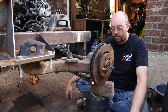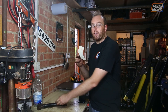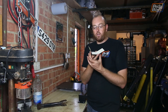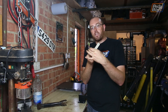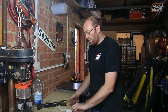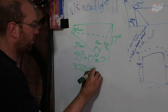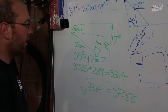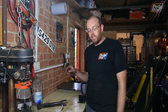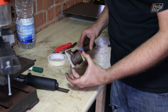These arms will be replaced at some point with something far more adjustable. Now we need to make a bracket on the chassis for this to fit into. We've measured it — it's 55mm wide — and made a nice cardboard template that wraps around it at the right angle. Unfortunately we didn't account for the width changing when we parallelogram it into position, so we've done some maths using Pythagoras. The length works out to about 57.5mm, so we tape the template back together a bit longer and then make it in metal.